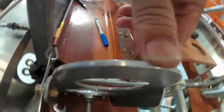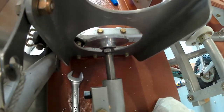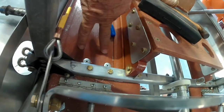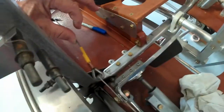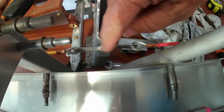Ideally, for me, these pedals should probably be on this carry-through. But if I do that, they're not going to be at the right height and I'm going to have a problem with the brake master cylinders locating them as well. I could have located them aft of that carry-through piece, but then I would have had problems with the brake master cylinder again. If I do need to move them, I probably still can — I'll just have to re-swage this cable and either remake this front cable or make a link — make it longer, or make another link that attaches to that one. So I've got options.